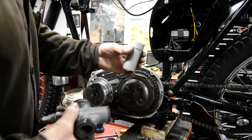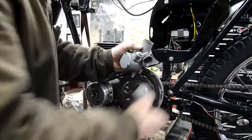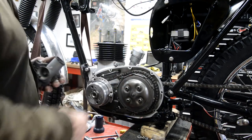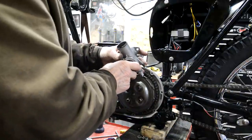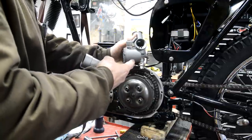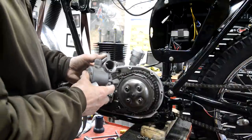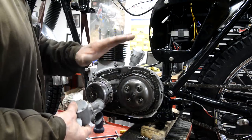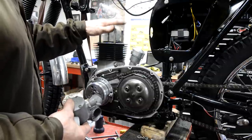And so it came, it was like $20. Not a lot, but you know. I go to put it on, so I check, and this engine should have a 375 carb. And it's got, not a 375, yeah, 375, it's got a 376. Now, according to the parts book for the later C15s, they put the 376 on the sports model. So I'm wondering here, with this engine number, this is definitely just a '59 BSA C15 Star. The casting number on the cylinder head was the same. It's the right one for a '59 bog standard model.